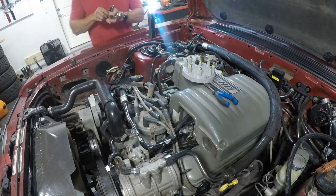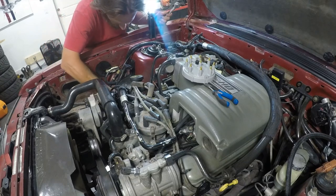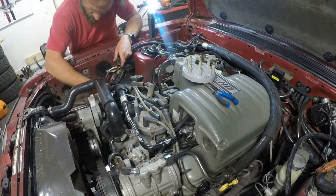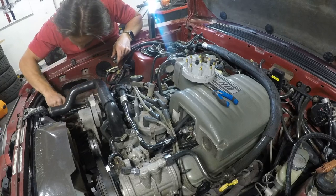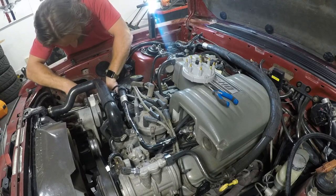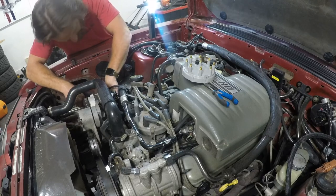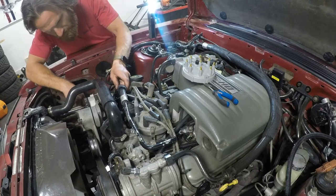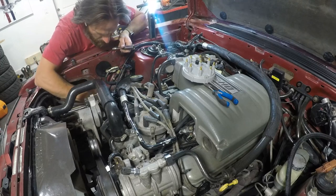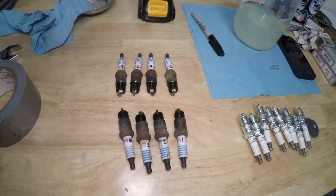Now I'm going to get after pulling the plugs out of this motor. Get yourself a spark plug socket — essentially they've got a rubber boot inside that holds the spark plug nice and secure. Have yourself a couple of extensions and possibly a swivel, because especially on the passenger side it gets a little tight if you're working around any of the stock air pump plumbing. Right to tight, left to loose — back those out and get them on the bench.